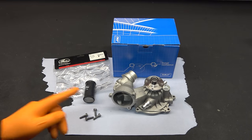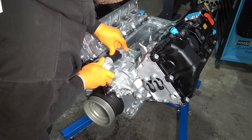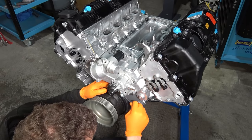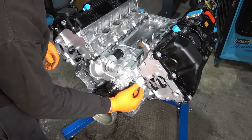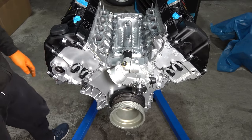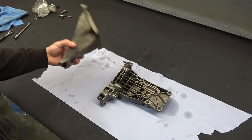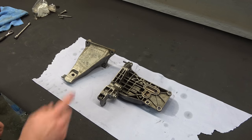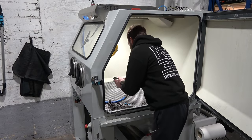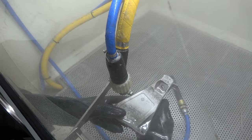While we have nice and easy access we're going to install a brand new water pump. Silicone spray, and then good and tight. We have a cap here, then a brand new temperature sensor. The pulley, thermostat, and the vacuum pump we're going to install once the engine is back in the car. Same goes for the intake manifold. We have the engine mounting arm and alternator bracket — this is now ugly metal, and you know what that means. Time to make it look better than brand new. Step into my Vixen surface treatments vapor blasting cabinet.